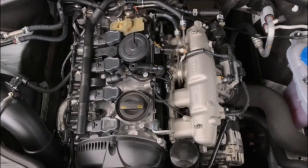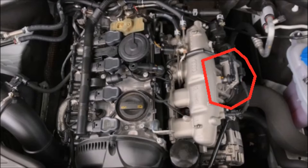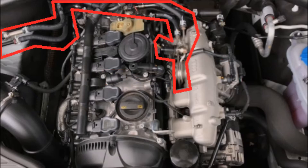Here we have a real compact engine design. This is the 2-liter displacement with a 4-cylinder. We have the air intake manifold — nothing too fancy, real basic. Here we have the throttle body and a couple of components on it: the throttle body position sensor and the idle control valve. Right here we have a little system that is part of the vacuum system, coming off the intake and going into the engine, and also part of the secondary air injection system.